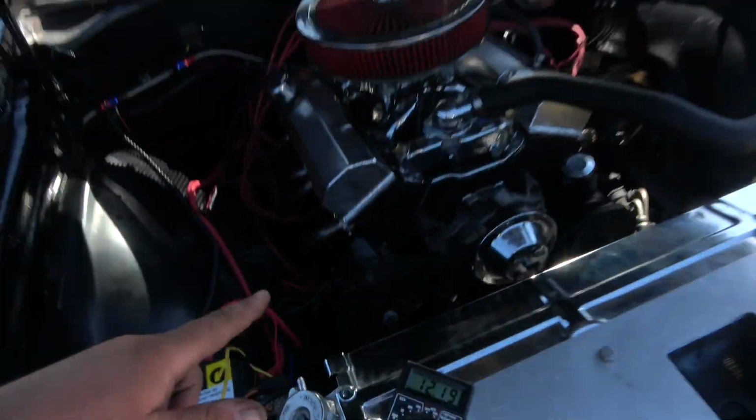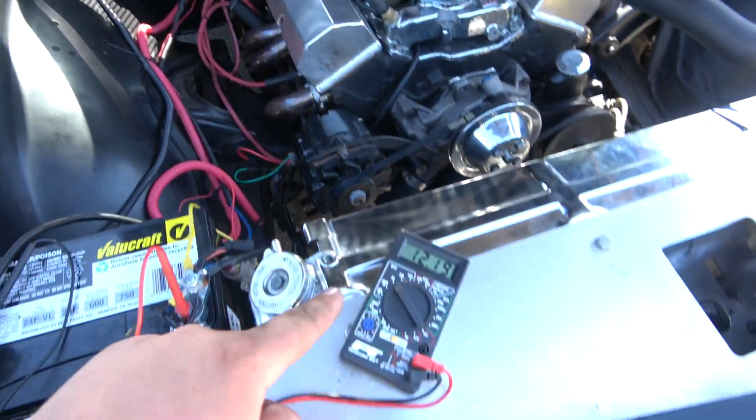Okay, so the new alternator is in. It's wired up. We've got 12 volts on the battery. Hopefully no wires got switched around. I think we're in the clear. It's very simple. So now we need to jump it. Once it's jumped, we'll see what the voltage reads when the car's running, and hopefully we're all good to start driving it again. But if this doesn't fix it, we've got to dive a lot deeper into the wiring in this car, because something is clearly wrong.